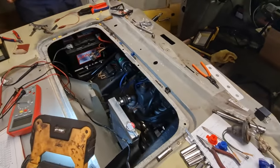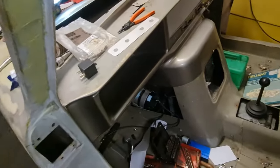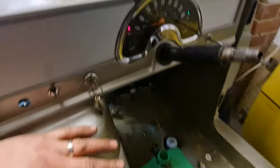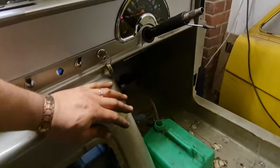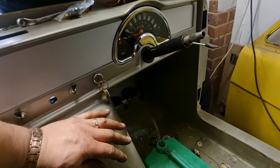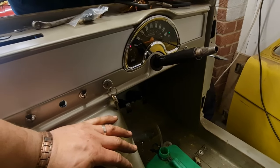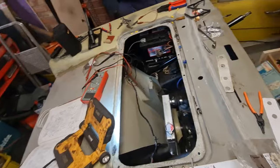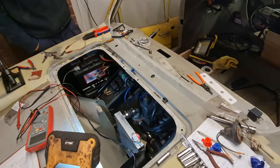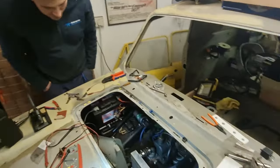The ignition light goes off and it starts on the key which is absolutely amazing - it's not done that ever. What if I unplug it from the sender? Yes, it's gone out - so it's a dodgy sender. So the wiring's okay, it's the sender. Or we've got no oil pressure - which is slightly worrying. It must have oil pressure - but then I built the engine. You've run it for a while though, and it's not clattery, so there's oil in it. Dan got here at nine this morning and it's now about half five. We're going to do a bit of investigation and come back to you.